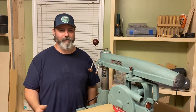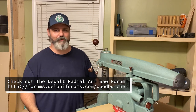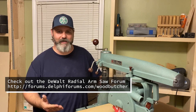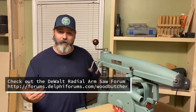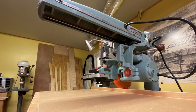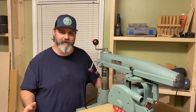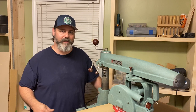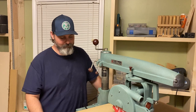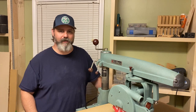The purpose of this video was not to give an in-depth tutorial on how to rehab one of these saws — there are great videos and resources online that cover various aspects in depth. I wanted to show that it's actually worth taking one of these 60-year-old tools and rehabbing it and incorporating it into your shop. What I essentially did was disassemble the whole saw, clean the individual pieces, rewire it, repaint it, build a new table for it, and calibrate it. It's a great saw that cuts a perfect 90-degree angle.